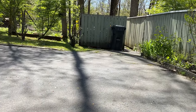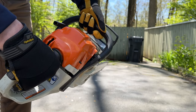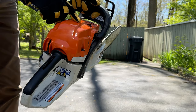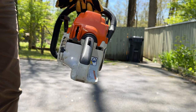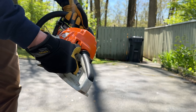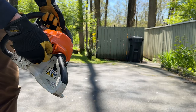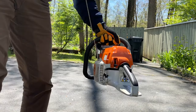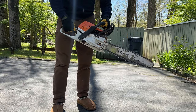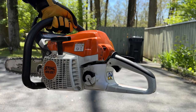Let me show you. Button is depressed. I'm going all the way to the bottom and then I crank. It seems to be going on — this now popped out. Very important: even though you think it was about to start, don't continue cranking in this position. Move the choke to the next level up position. And that's how you start your Stihl every single time.